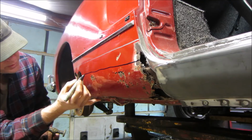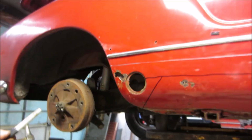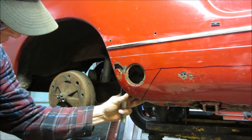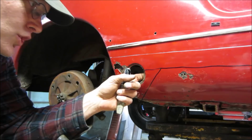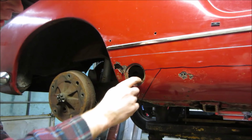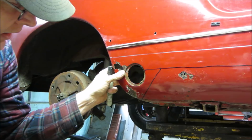Let's detour for that tubing hole in here. Let's not clip that yet. If this is all gone or all Bondo, I'll probably do it in one panel. I just don't want to have to recreate this hole. It's two different separate pieces of metal. I guess maybe we can cut off the outside, leave this inner lip here. You either want to take the whole thing out or you won't take any of it out, right? That's all pretty bad now.